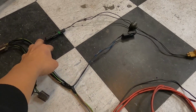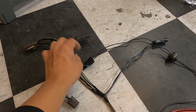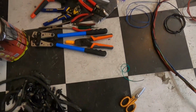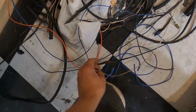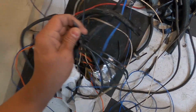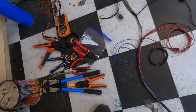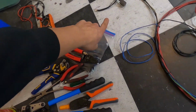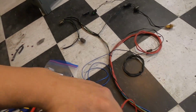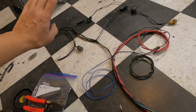To see the side marker, like I said, I went ahead and made new connectors, because the old ones were all just trash and they were using this junk. They were using stuff like this. Look at this. Excuse my French. Crap like that. So we don't want that. Eliminated that. Now, as far as your grounds go, boys, make sure your grounds are very, very secure. If anything is not grounded properly, you're going to have issues. I'm just telling you right now.